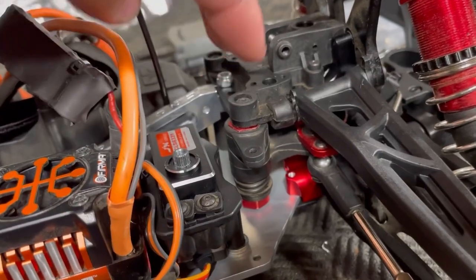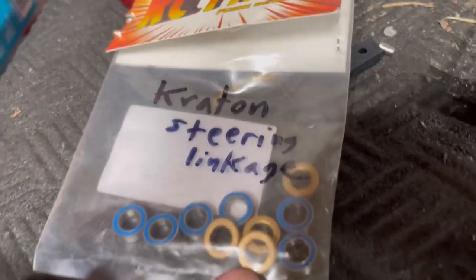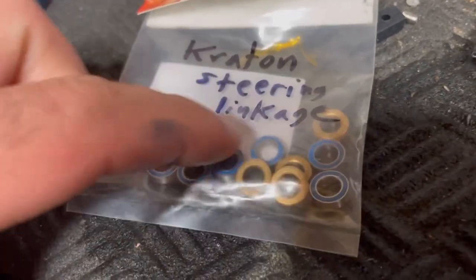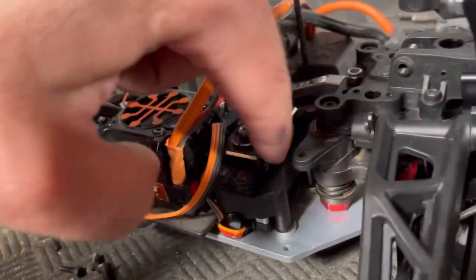And Arrma used bushings inside the steering linkage here instead of bearings. So I took these brass bushings out and put these bearings in. I do have a more in-depth video on that, and I will link that video in the description of this one. While I'm at it, I'll have a link to this servo in there too.